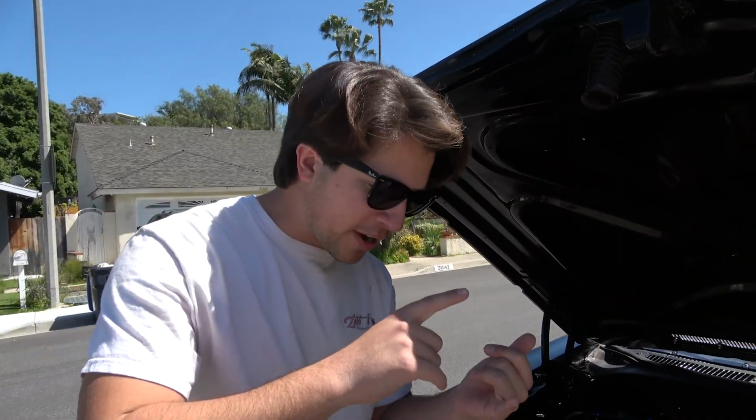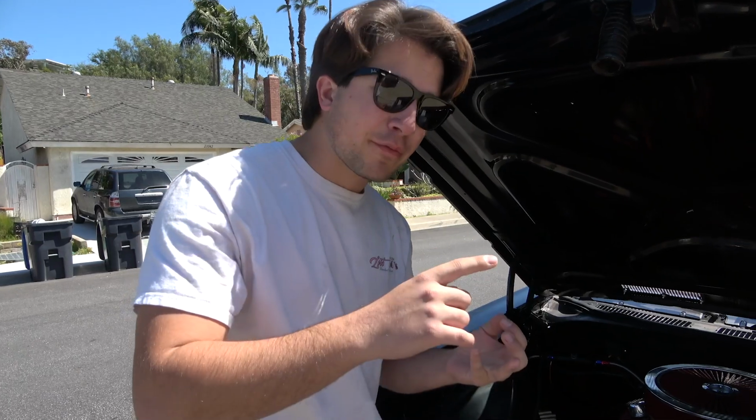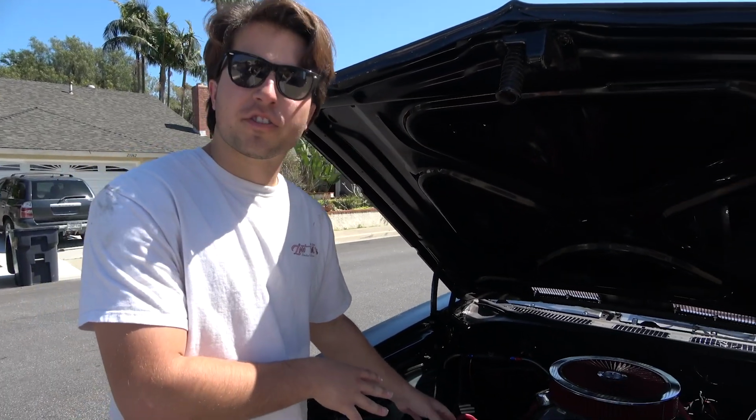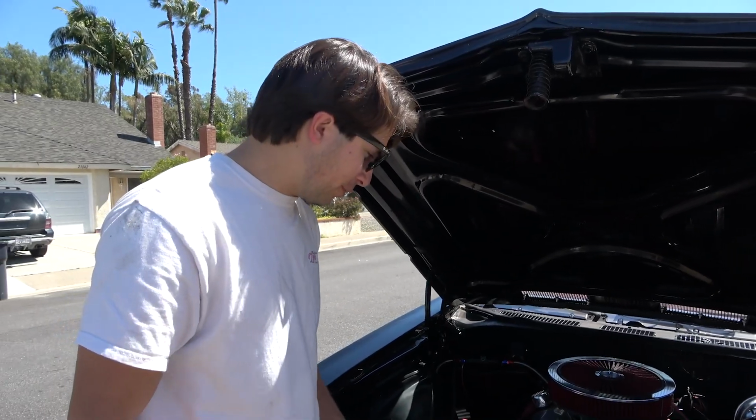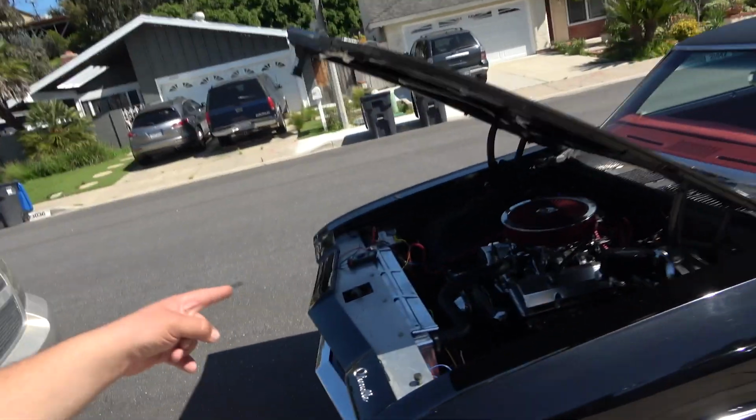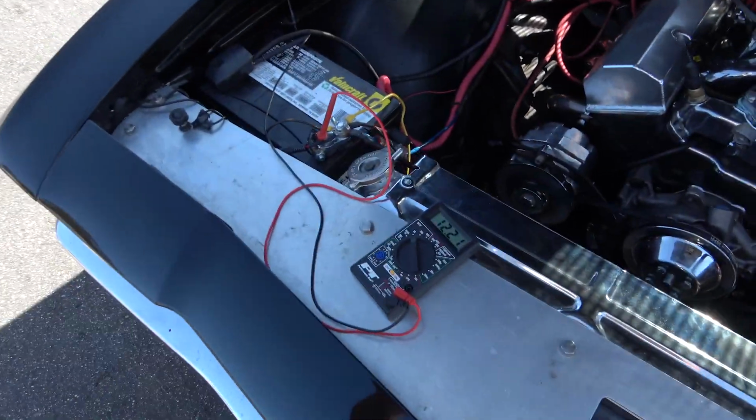Now, I have read the gauge inside the car. My little Phytech system has a gauge built in. I've got 2 gauges saying that it's running at like 9.8 volts, and I'm like 99.9% sure that the alternator is done and it's time for a replacement. The belt looks a little worn too. Let's replace this. Okay, I already attached the multimeter on the car right here, and we're at 12.2 volts.